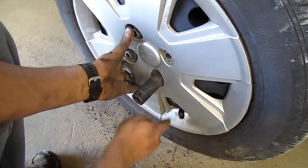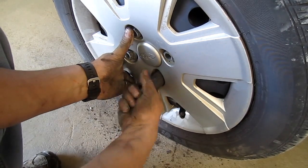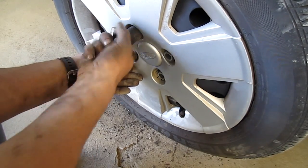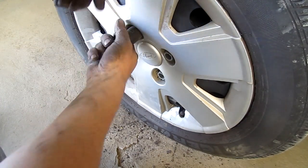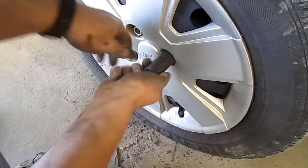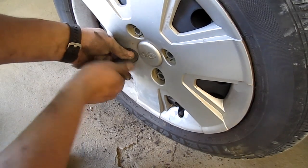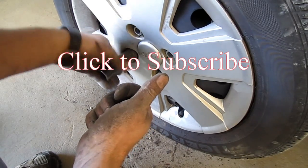Make sure you get your hubcap on correctly so you don't cover up your valve stem. The last thing we're going to do is tighten down the master cylinder. Make sure you pump the brakes really well before you even start to move the vehicle, then take it for a drive, come back, check your brake fluid, and make sure the master cylinder cap is on tight. Torque your wheel bolts down — I torque mine to 90 foot-pounds, which might be overkill but it's a good idea. Thanks for watching — hit that subscribe button and give me a thumbs up if this video was helpful!